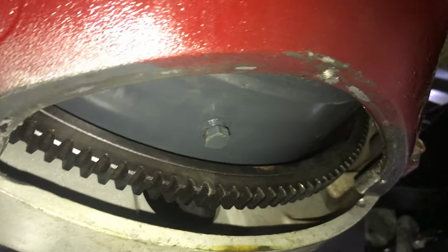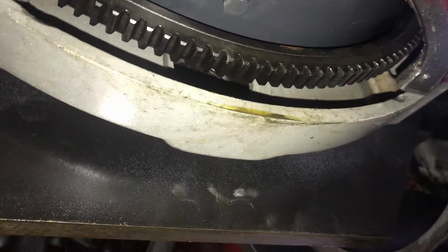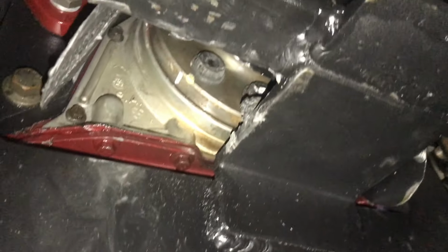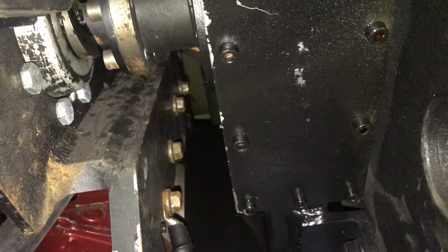Okay, I've got the inspection cover off the bottom. Just trying to make some plans on what we're going to do with our revamped starter system, as I mentioned before. It's going to be hard to get pictures probably of this gearbox, but of course that's the main part of a 2-engine build. We've got a plate on the back of each engine with a drive hub with some stub shafts coming out of our gearbox. Got intermediates that go to one gear that's in the middle, which is our output and also our input.